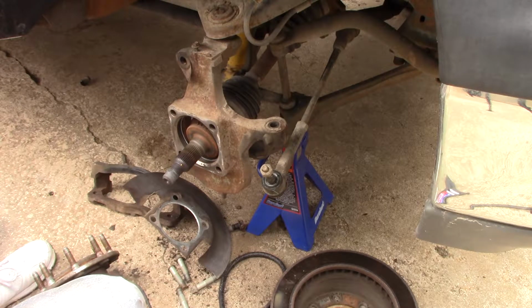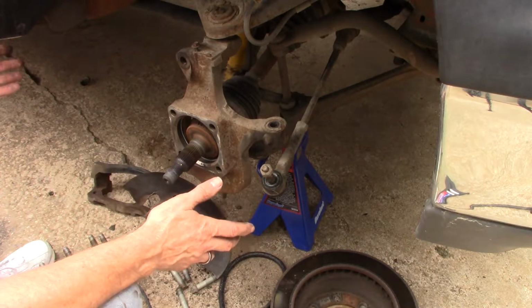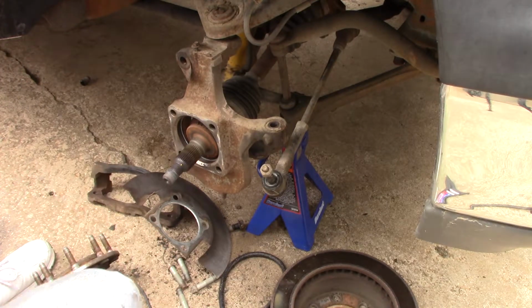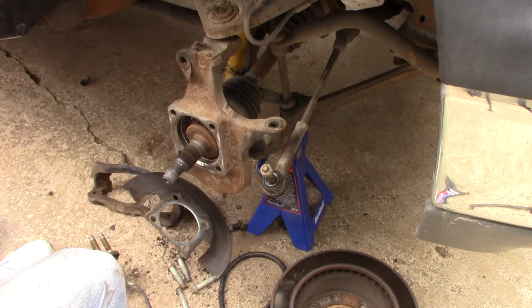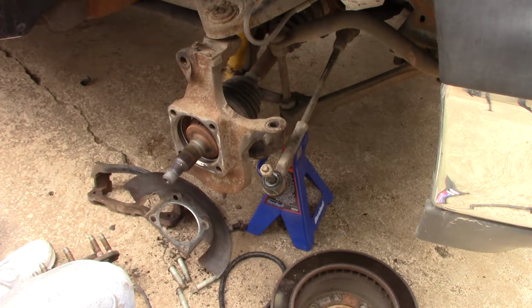understand that this was a truck that originally had 245/75R16 tires on it, and it has 285/75R16. So you're dealing with about a 32-inch tall tire, which is a lot taller than what they were. They're a little bit wider, and that puts excess stress. It's also heavier. It's rotating mass. There's a lot of things to consider. It's harder on braking. It's sometimes better on fuel mileage because you've actually geared it a little higher, plus again more rotating mass, but just around town it doesn't do you any good.